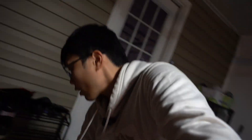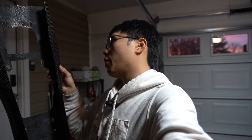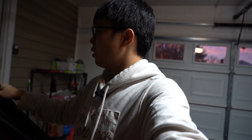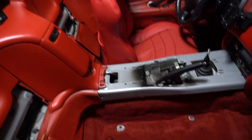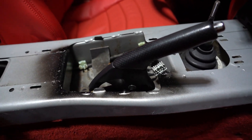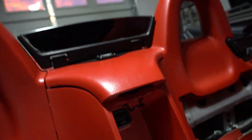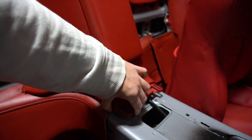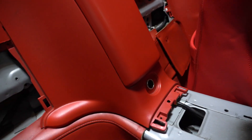All right, we got the old piece out of here. This is the old carbon fiber overlay — I think it might be genuine carbon fiber, it is pretty light, but it's pretty beaten up. There's a bunch of cracks throughout it. Basically the way we had to remove that was to come into this area and remove the piece over the cover that has the cup holder, and then there are three screws behind this panel — one screw here, one on the driver's side, and one at the very back. Once you have that off you should be able to just lift this up ever so slightly and pop the cover off.